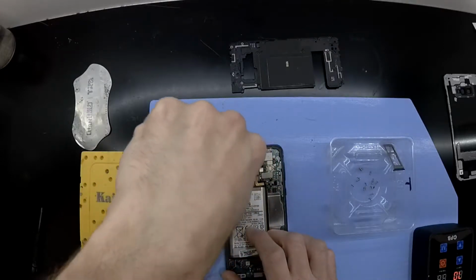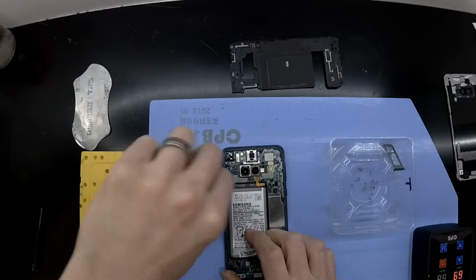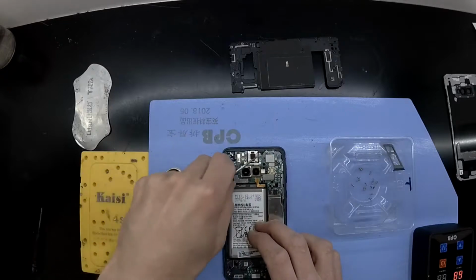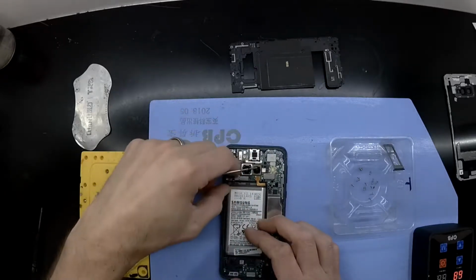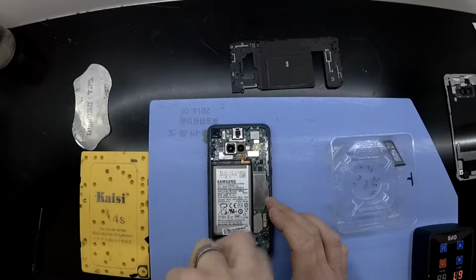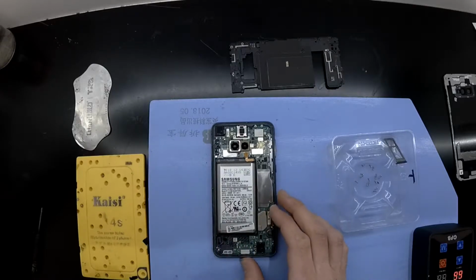I did also start removing the fingerprint scanner / power button on the side. It has 2 screws, but turns out it wasn't really necessary to move to the replacement frame. Your frame might vary, but on the one I received, I don't need to swap it. And there's also 2 Phillips head screws down at the charger port, so take those out as well.